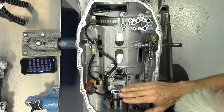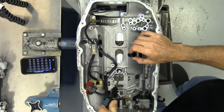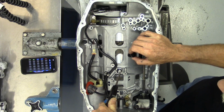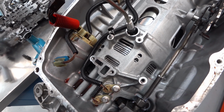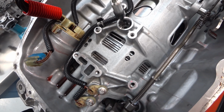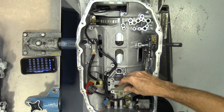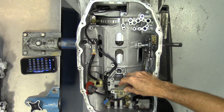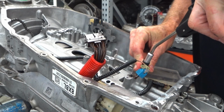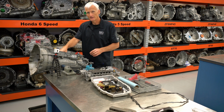That sounds good. This one right here under the bridge seal, I'll go ahead and take it out. That is our 1278R, or our C1. And we can actually watch it apply. And using an air test plate, I can go through and check that C2 clutch, which is the 12345R, and we'll see how it seals. Everything seems to apply pretty well, so that is a good sign.